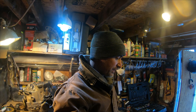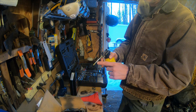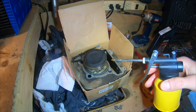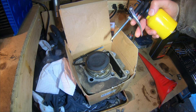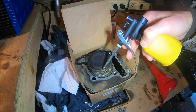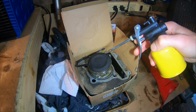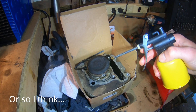Let's see if that was the last step we needed to get this thing cranking. A little 10 weight 30 — I'm just going to do a couple of squirts. The idea being: I'll put this in the spark plug hole and we'll get some oil built up here that'll seep down around the rings, but also as I manually crank the piston up and down it'll coat the cylinder walls, and that should free things up to allow it to crank and start.